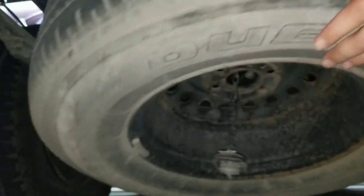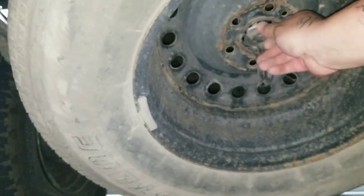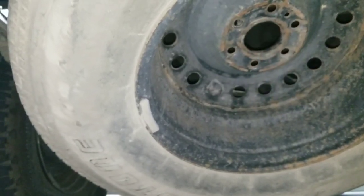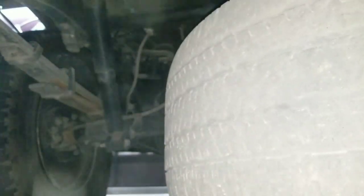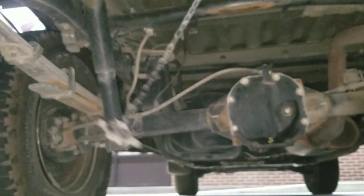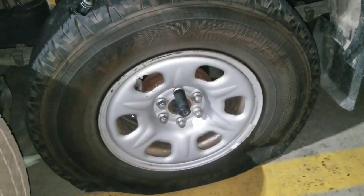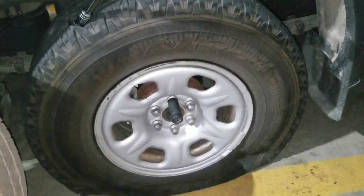Now what you're gonna need to do is lift your tire up. I'll be able to do this with one hand — put that piece right up through her. All right, we got our tire loose, so now what we're gonna want to do is go ahead and break these nuts loose, just so that they're loose enough to turn by hand, and then we'll go ahead and jack up the rear axle.